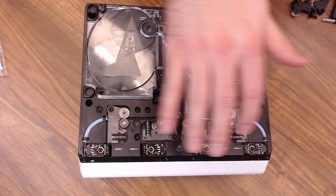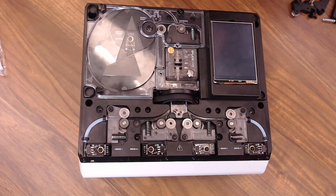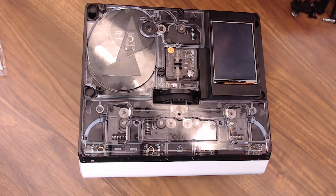The splice core is in and we're pretty much done with the incoming portion, so we can go ahead and put the covers back on. Slide in the homing switch cover, use one of the new thumb screws, and put on the incoming filament cover with five new thumb screws.